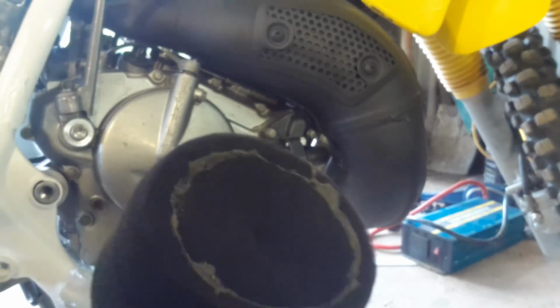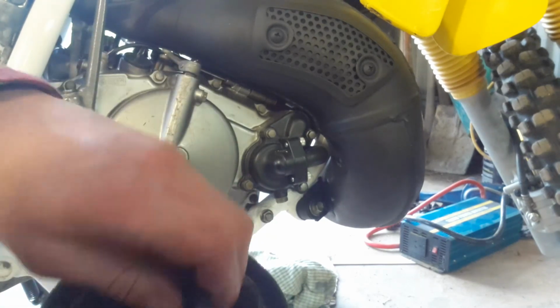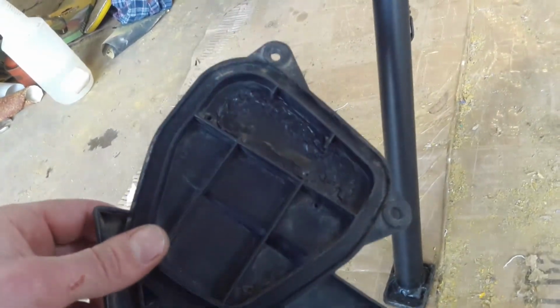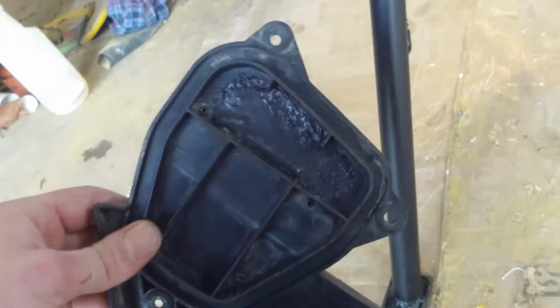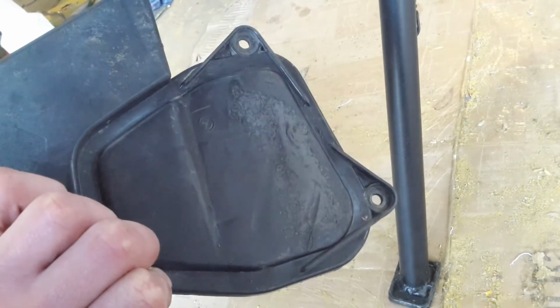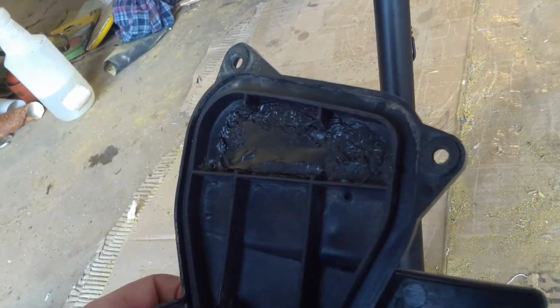Right, so first up, one of the little things, just installing the air filter washer. Now that I have the airbox lid off, you can see how I plastic welded up the speed hole that the previous owner cut in. As you can see, no hole, but you can tell where there was one. Replace the cheapo cap heads with some nice Japanese hex heads. These are the correct lengths too, so the fairing's able to sit up against the tank.